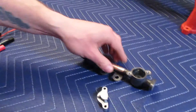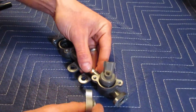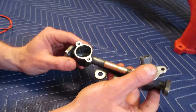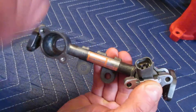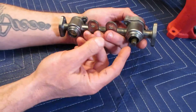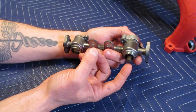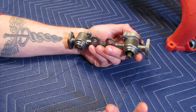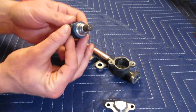For a side-feed fuel injector, this is the side-feed fuel injector fuel rail. The injector fits into the fuel rail like this, with a cap that goes over it, and there'll be high-pressure fuel in the rail. The ECU of the car sends a signal to these connectors, telling the fuel injector when to open. When it opens with high-pressure fuel, it shoots a high-pressure atomized mist of fuel through the tip into the combustion chamber at the right stoichiometric air-to-fuel ratio, producing the combustion event.